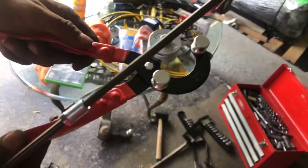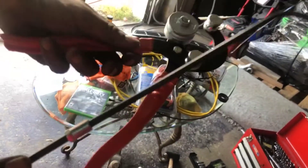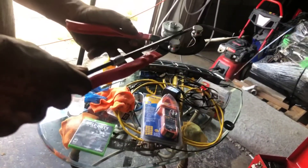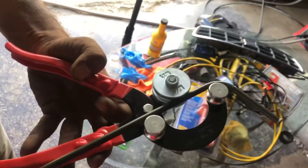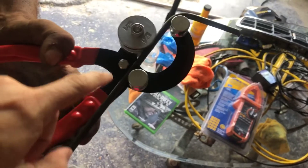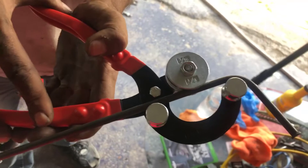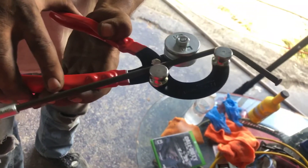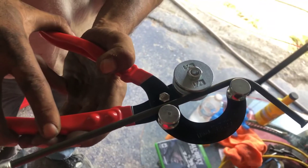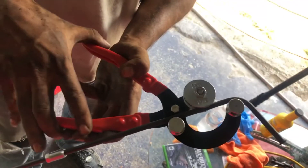It's a lot of interesting bends but we've got to replicate them. When you see that wheel come down it looks like it's going to bend to that angle, but you're just creating a right angle — that's what you're doing. It's going to create the right angle we want, the bend right there, which is exactly what we want. We've already got that one and this one; now we have to create that one. If we mess this bend up we'll have to buy another line. Squeeze slowly — I don't want that wheel to get too far over and mess it up.